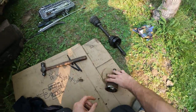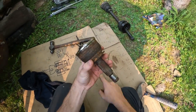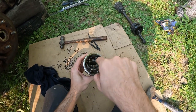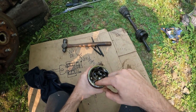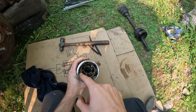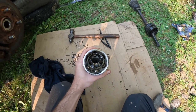Just like that. Now we have our shaft and we have our stub shaft, or the cup, like we said before. And now what we're going to do is take this and flip the bearing cage, and then we're going to take all the balls out and slip all that junk right out of there. So let's remove some balls.